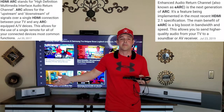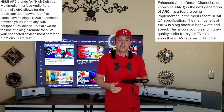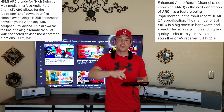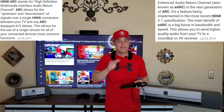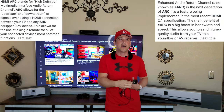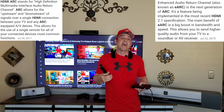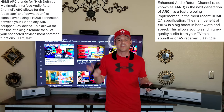You could use the ARC port as just an HDMI input for a Blu-ray player, but if you plug your Bose 700 into the ARC support, you'll now have audio from anything playing through your TV — Xbox, Blu-ray player, cable, it doesn't matter. However, a lot of people found it wasn't working. Out of 10 people who asked me, 10 replaced the HDMI cable, and 9 of them had it immediately start working — suggesting some cables shipped with the 700 and SoundTouch 300 were faulty.